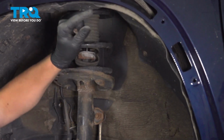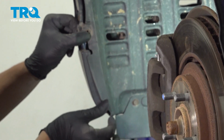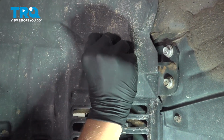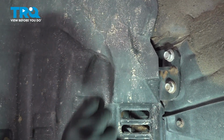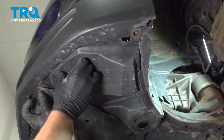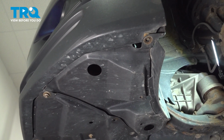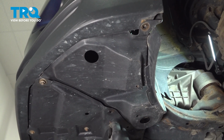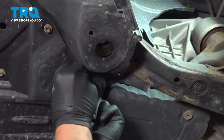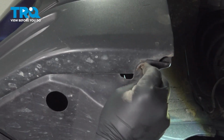All of this stays on the outside of the fender. And then put this inside of the bumper. I'm going to put 1 clip right here to hold it up. Tuck this part into the bumper and under the main splash shield. 1 10 mil there. The fine threaded 10 mil goes here. And we'll put our one clip back. And one more 10 mil bolt right here.